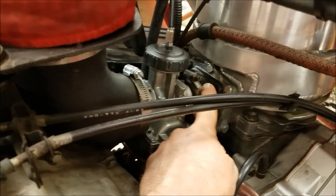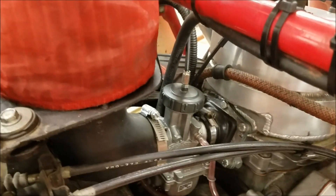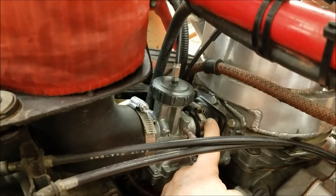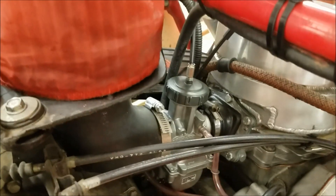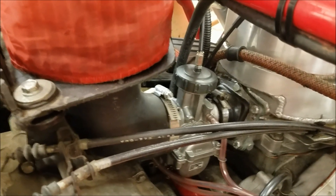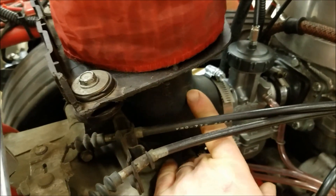For most of the motors, I run a CR 250 centered intake manifold because it flows straighter into the cylinder. I prefer four-petal reeds and a stuffer that's been massaged. A big item that a lot of people might not think about is the 90-degree elbow feeding the carburetor.